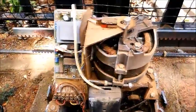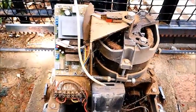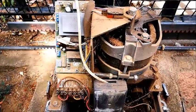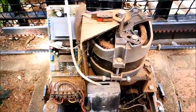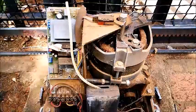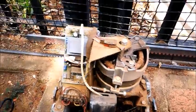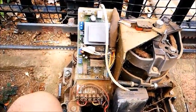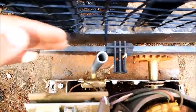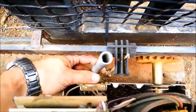Obviously when something like this happens, it does open but just doesn't close. The motor is still working. It's probably some switching on the PC board that's gone, or a wire, or these limit switches on the back.